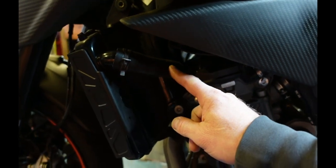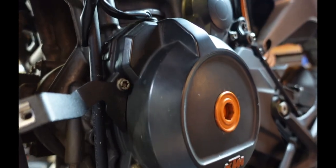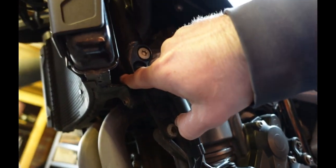So this final cleanup - making sure everything's shipshape and tightening up all the bolts - is now going to involve taking the radiator off. I think I've located where the leak's coming from. There's a hose here at the other end, and I think the jubilee clip, which is tucked right up there, has got a bit of corrosion on it. So I'm guessing that's where the leak's coming from. I'm going to drop the radiator, take the hose off, make sure there's no cracks or splits in it, and then put it on with a new jubilee clip.